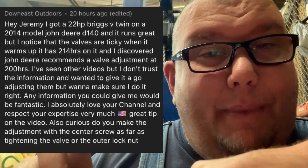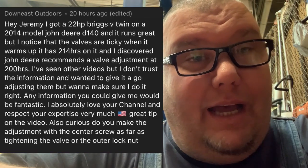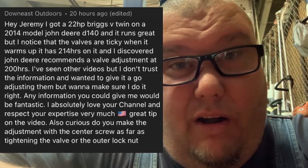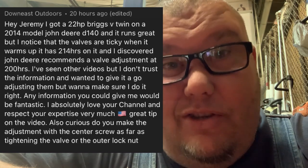This is a really good question about adjusting valves on a V-twin Briggs and Stratton engine. It's clattering when it gets hot, which is completely normal when valves get out of adjustment too far. The mechanical compression release on the camshaft won't be working because the valve lash is too far out. The only thing you need to do is make sure your engine is at top dead center on the compression stroke — that way you can adjust both valves at the same time, whether your rocker arm adjuster has a single screw or a stud with an adjuster and a nut. The procedure is all the same.